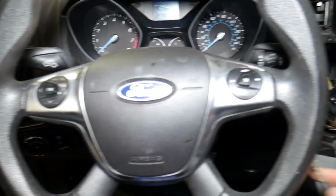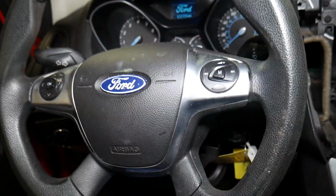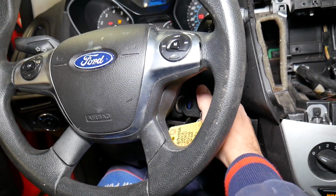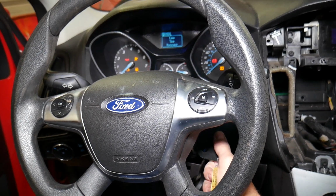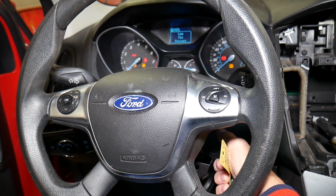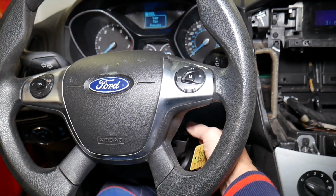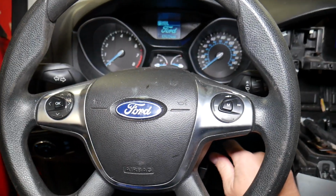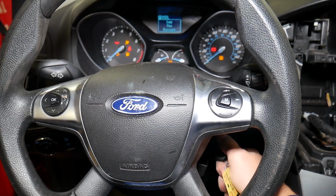Before even starting, I recommend to connect an OBD scanner and clear all the codes from the system, and make sure that you don't have anything. And if you don't have a manual fuel reset switch, you may need to turn the ignition on and wait about 15 seconds. After that, turn it off. Cycle it about 3 times. While you cycle it, you're going to hear for the first couple of seconds the fuel pump, usually under the rear seat, building pressure. And we'll demonstrate if that car is now going to start. So let's see that now.